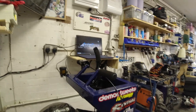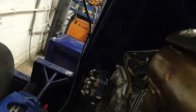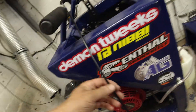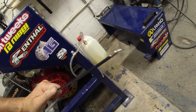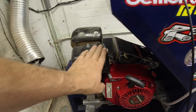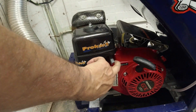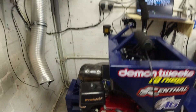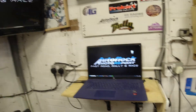The engine is all filled with fluids and I've got it on the engine dyno now, all tensioned down. I've installed the bully clutch — the twin plate clutch — got the chain on, fuel lines all rigged up. I'm not bothered to install the throttle cable linkage because this is set up for a different carb, but I can still use the hand lever to do a decent power pull. I've got the laptop plugged in now.